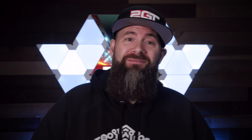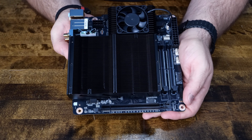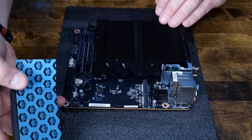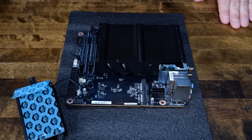There are some incredible features I want to call attention to on this board. First, the included custom-designed CPU heatsink — it's unique and low-profile, so just add your favorite 120mm fan and it's ready to go. The board also features a dedicated NVMe cooler to maintain optimal temperatures for those PCIe 5.0 M.2 NVMes, which removes easily with just two screws and comes with a pre-installed silicon pad. Minisforum was kind enough to send us this board — it's compact, powerful, flexible, and energy-efficient for home labbers with high power costs.